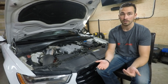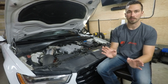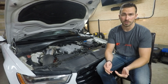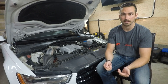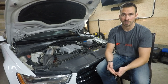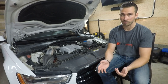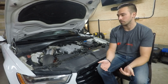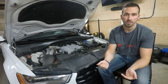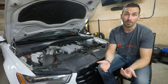It's no different from when we fill up our coolant system and bleed air out from the screws. Personally, I haven't run a divorce system on my car. I've optimized my supercharger cooling loop and it does a great job keeping my IATs down nice and low, and I can make excellent power. I did my 10-second pass on a normal, optimized OEM loop without divorcing. I didn't feel like I wanted to add complexity to the loop. There are some benefits to running the divorce system — just make sure you've got a good one.